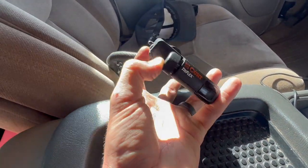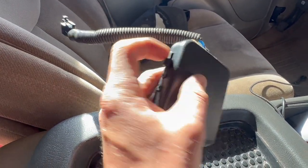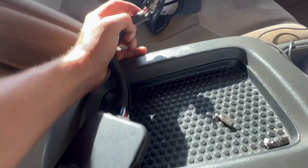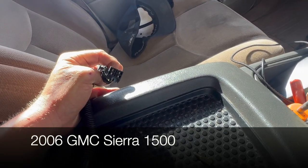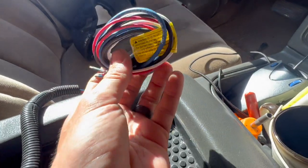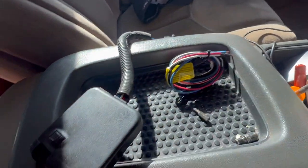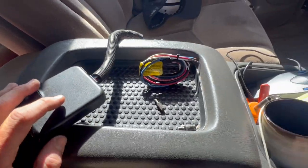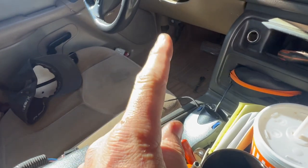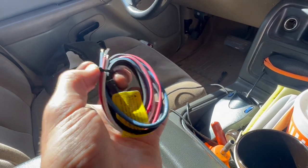Looking at the Prodigy up close: you have manual brake control, power, and level — how aggressively it applies. One difference is the wiring harness. The Curt harness came with a default plug for the truck — basically plug and play. The Prodigy wiring is more universal and not a default plug. Since I'm not happy with the Curt and haven't seen great reviews of it, I'm going to cut the Prodigy pigtail off and splice it to the Curt harness so I don't hack up the truck wiring.